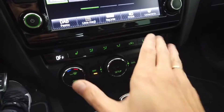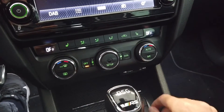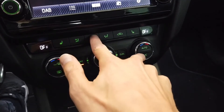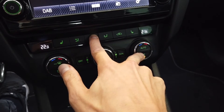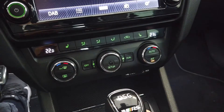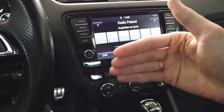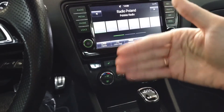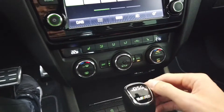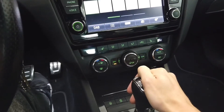What you need to do is turn on the ignition. When the climatronic system is on — it might be off actually — you need to press and hold at the same time two buttons: the AC button and the front vent button. Press and hold those two for about three seconds, and after three seconds release. You can see that those two indicators are flashing, and you will hear and notice that the air is coming out from the different vents. Each flap is moving to the end positions at the start and at the end, so the system knows how far it can go on either side. After that you are back to normal operation mode — you can turn off the system or use it as usual and check if the problem disappeared.